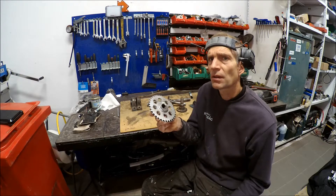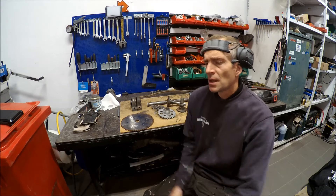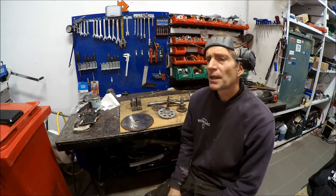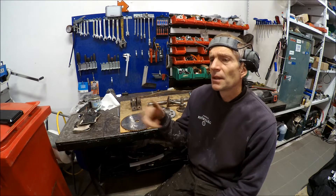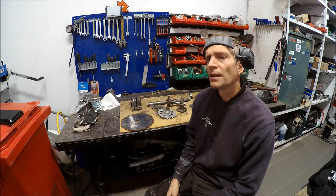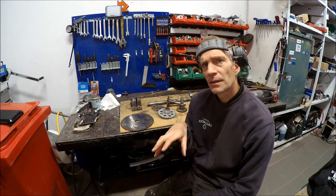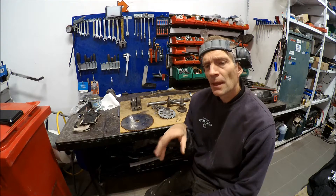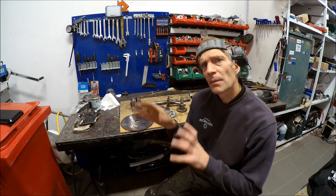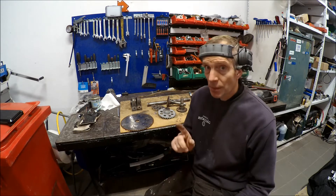So it will be almost half the gearing — twice as strong when it starts up. I also have a plan to replace the motor with an enclosed water-cooled motor, because the RPMs will be quite low and I don't think the motor will get enough cooling. If I do that, I can also use this fan-cooled motor in the electric snowmobile, and I think I would try to use the fan to warm up the battery pack in that one. So that's one of my plans for upcoming projects.